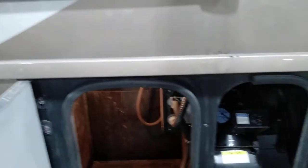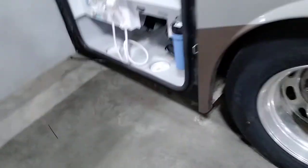These transfer switches do have some surge protection. However, it is single event. So if it takes a major surge, it will die in the process and you'll have to replace the transfer switch. So we do suggest you consider purchasing a quality inline surge protector. Go in there, in front of it.